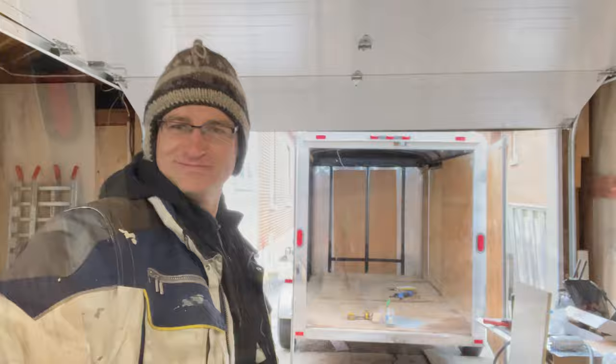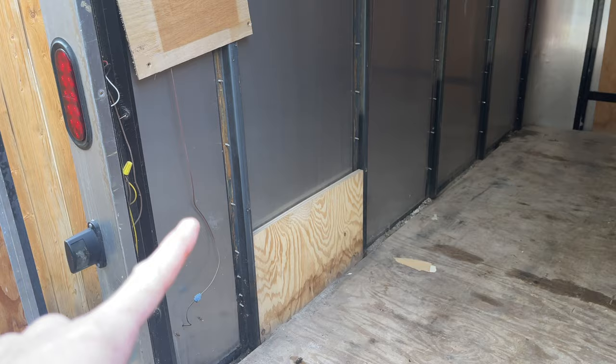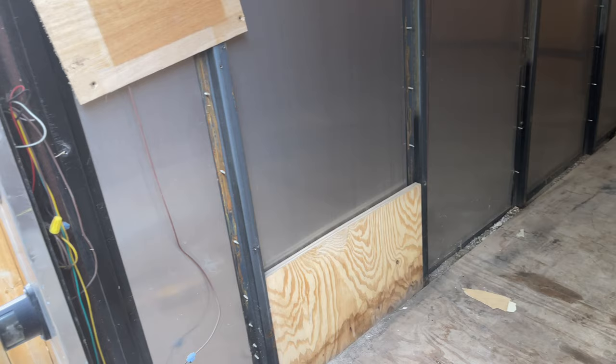Our first step is to pull these panels off. Once I get those panels off, on this side I'm going to put my plug for my shore power, and on this side I'm going to put my fill for my water tank. I'll get those marked out. I'm going to put half-inch plywood on this side just to beef it up a little bit and then cut the hole for the plug and for the water fill to come through — something to screw to.